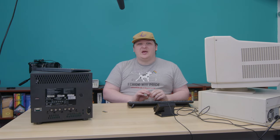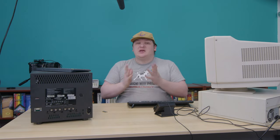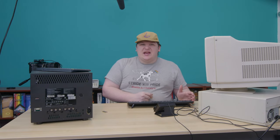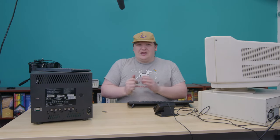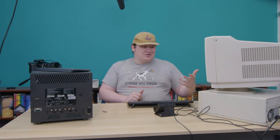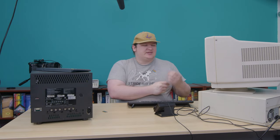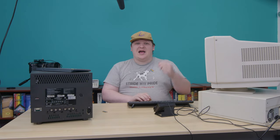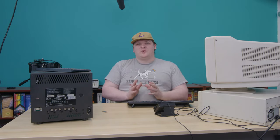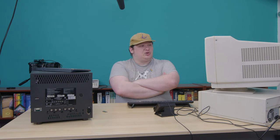Then when all those EGA games came out, like Commander Keen, they used that dark yellow for the ground, for dirt, right? So it needed to be brown. But on the PC88 and 98, it wasn't brown. It was dark yellow. So this monitor, theoretically, has a selection on the back that lets you pick whether to use the IBM or the NEC interpretation of those colors. That's what the manual says. Why it's not doing it, why it's ending up salmon, I'm not sure.